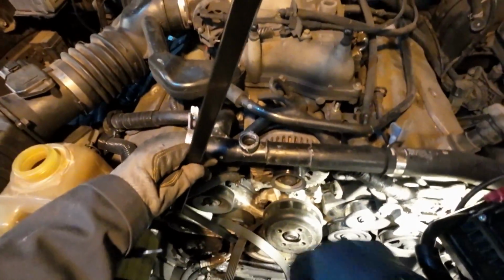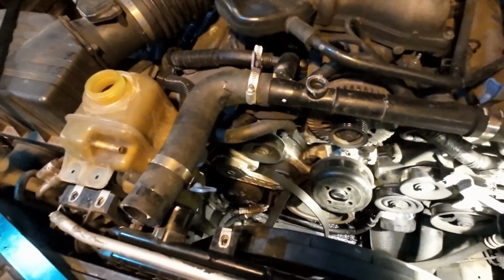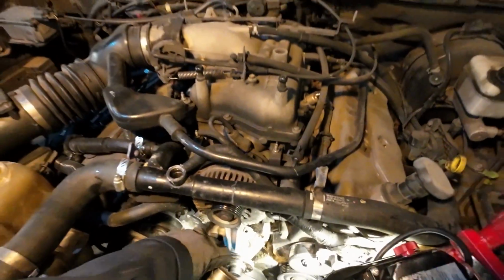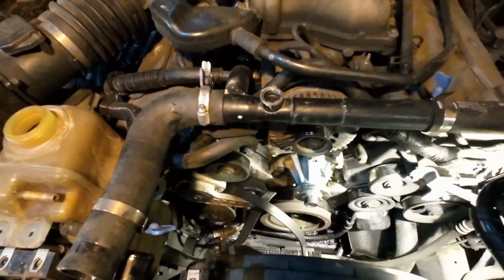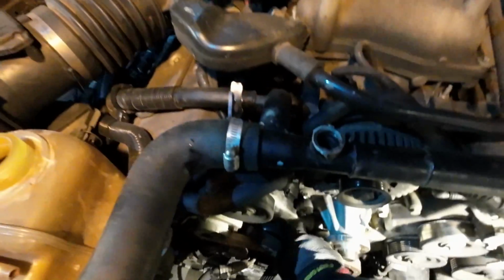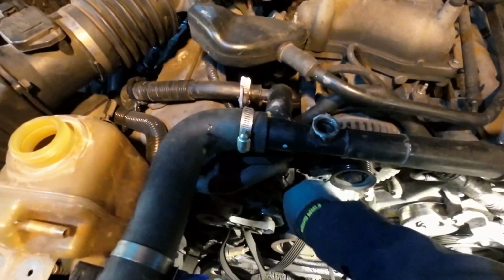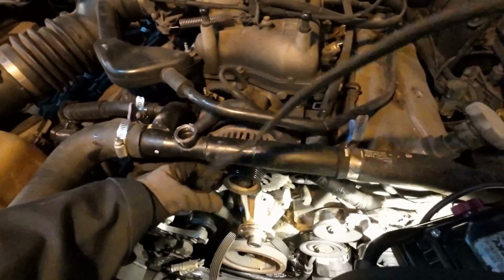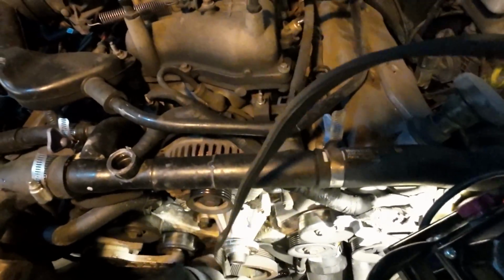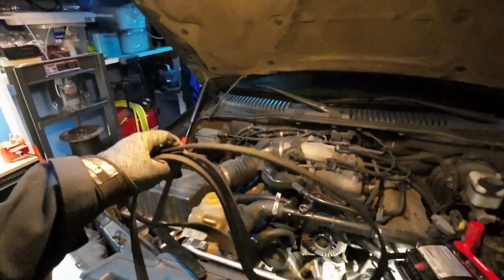But every vehicle that I've done this on has had issues with degrading of the heating system. I had a friend over here working in my garage, working on his Yukon, and I didn't comment on what he was doing, and he cracked his radiator after changing a water pump and thermostat, and I could have easily gave him a heads up on my experience, and I wish I did. But I've cracked radiators after this procedure just from air being in the lines, even thoroughly following the manufacturer's recommendation on the bleeding process when you're not using the radiator kit plus.